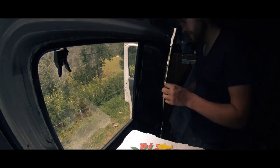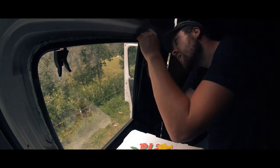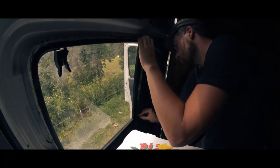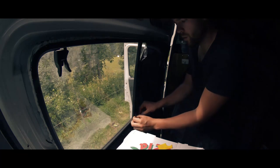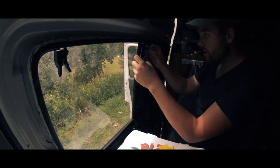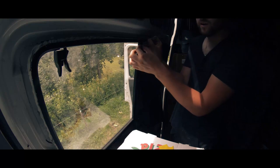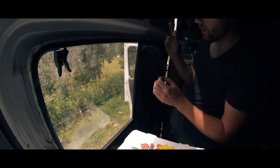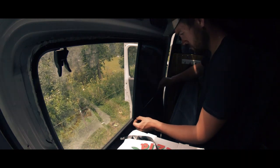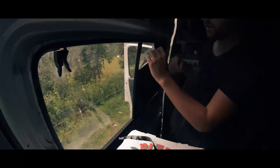And what you do, take your knife and you're just going to run it along the edges. And when you get to the bottom, you pull outwards and it rips the film. So I'll show you that here, look. So make sure it squeezes into the gap. Run your blade and then you rip away from the film and it won't tear into your piece. Just do the bottom. So the sticky back isn't taken off this yet, so it'll come off really easy, look.